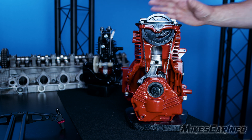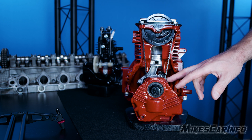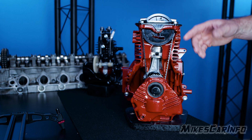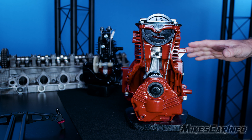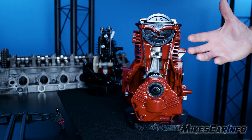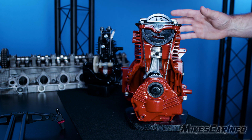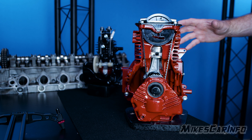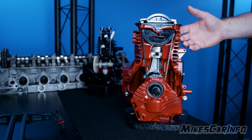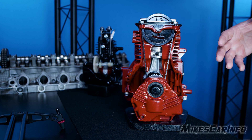What's not included in this example is your oil delivery system. There's typically a pump that pumps oil to everywhere inside — the connecting rod, around the cylinder walls, everywhere. There's a complete oil delivery system. There's also a cooling system. In this particular case this is air cooled, so you have these fins that act as a heat sink — airflow will flow past and cool this aluminum part of the engine around the cylinder. But most vehicles will have a liquid cooled system. There's actually a fluid — antifreeze — that flows around different places in the engine and transfers the heat out to a radiator, which releases the heat away from the engine.